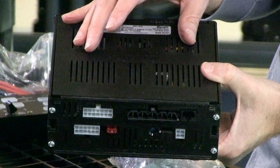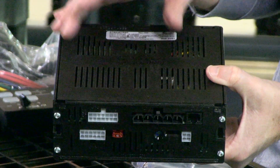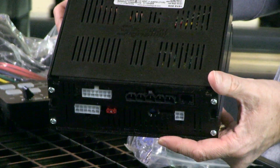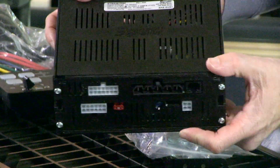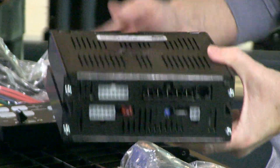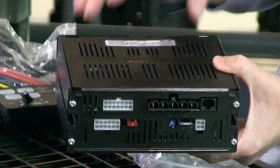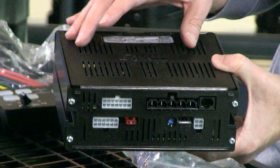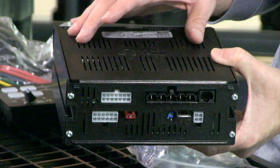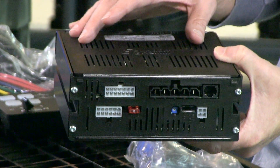The unit also gives additional power and signaling for other items you might want to use in the vehicle, such as a printer, radar, or GPS system. The nice thing about this, as always with SoundOff, is the built-in reverse polarity protection for those of us who occasionally mess things up. You can also do a horn ring scroll — connecting the unit to your vehicle horn, where depressing it changes your tones and tapping it again turns it off. Additional technical specs are available on the website.